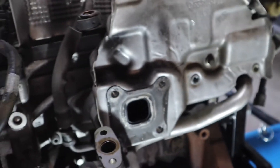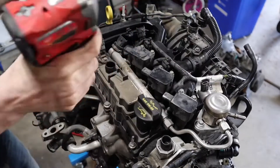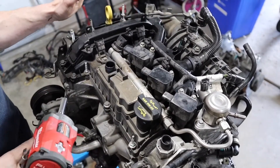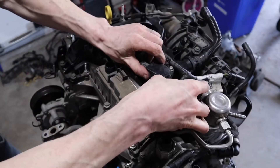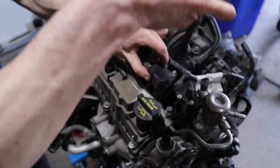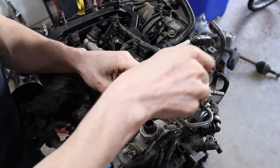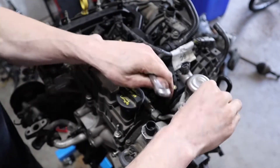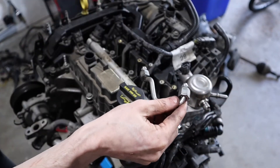Interestingly, these engines have no exhaust manifold — it goes right into the cylinder head, which seems to be normal nowadays. I've removed the engine harness and now I'm going to remove the valve cover. Here are the ignition coils. This is the high-pressure fuel line that feeds the direct injection injectors — generally these run like three or four thousand PSI when running. Three bolts and this injector rail should just kind of pop out.